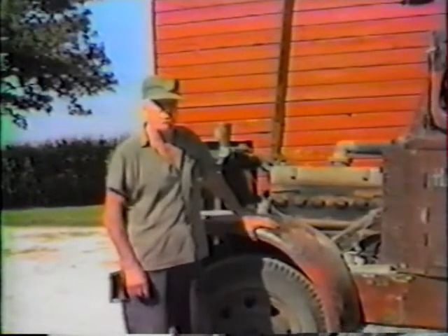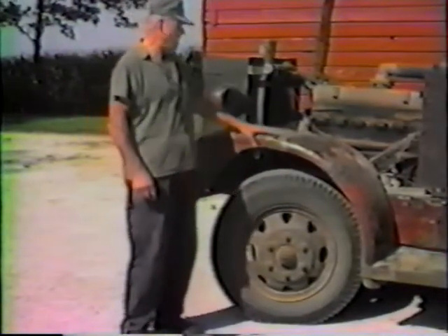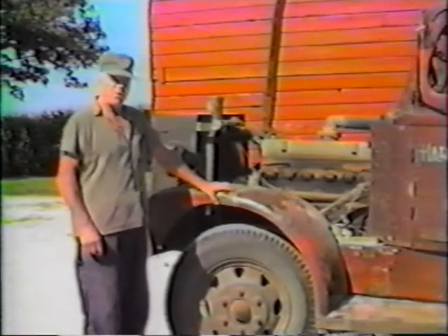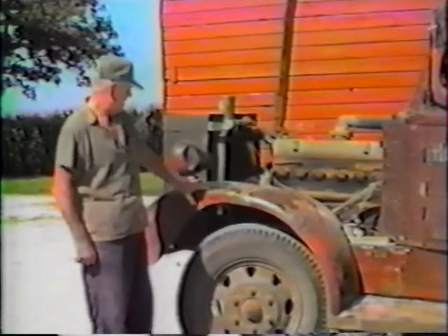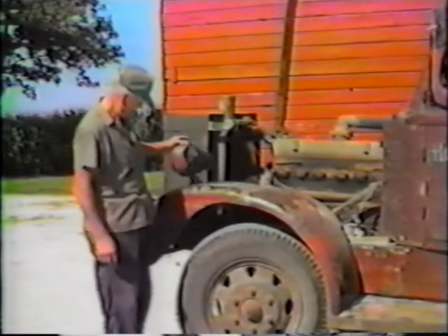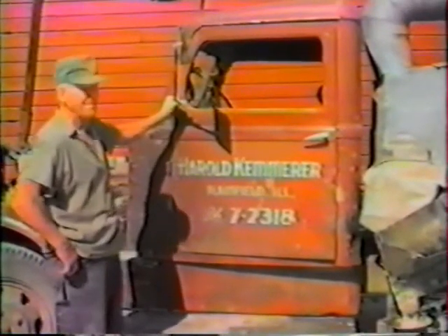This is a 1932 Lee Moon truck. One reason for buying it was because it had a good heavy frame. They had to move the fenders out about a foot in order to get the motor in to run the shuttle — the motor that was in here was not near big enough. This is a 468 cubic inch Buda diesel motor, which was taken out of a Greyhound bus. The green heater I bought out of the junkyard in Chicago — paid $75. It's pure copper all the way through. The telephone number is kind of out of date; this was all put together in 1950, and that was the telephone number at that time.